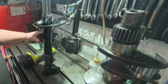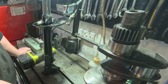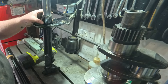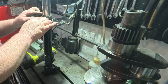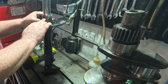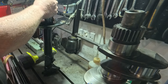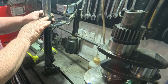They were fitted to the car but unfortunately the bushes rose and came out in use, and it didn't take very long either. So what the owner has done is put the bush back in with some Loctite — bearing lock — and crimped it over in four places at the top of the strut. The bush is down about 10 millimeters and it's just crimped over to stop it coming back out. That nipped the bush up slightly, and it was pinching the tube so the tube wouldn't go in.